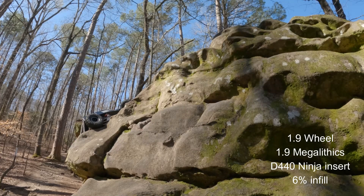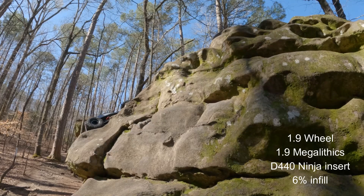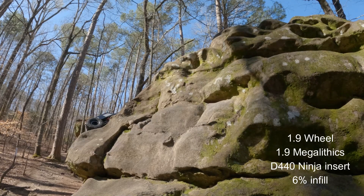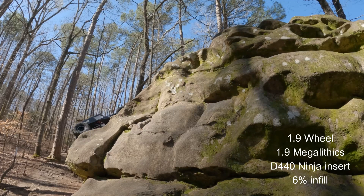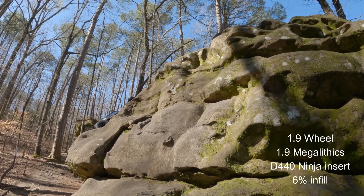It's falling off to the left. My old setup in these tires were hair buns in the front, which made it super, super crazy soft, and they were a little firmer in the rear with a different type of insert. I think I'm going to have to go with a similar setup and try that on these. It never falls over to the left like that — the front just walks over. The fronts need to be softer; the rears might work.